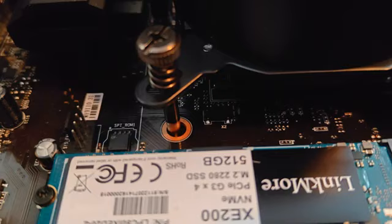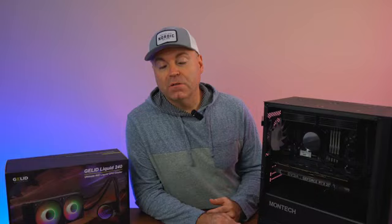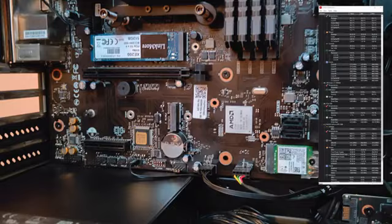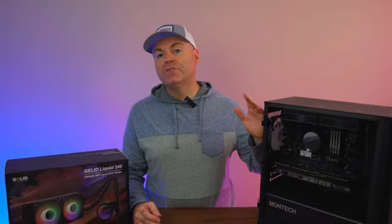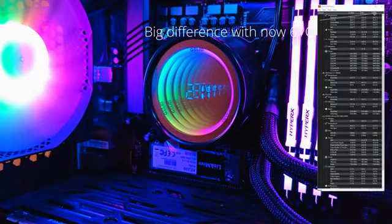You will see the temperature comparison — how the Ryzen 5 5600 performed before this upgrade with the 240 versus the old Omen 30L with the 120 AIO by Corsair, which actually makes that one for HP. The difference is big: 240 versus 120, and even in an open case the 240 performs much, much better. In addition, it's much quieter even at the highest RPMs, and it has a lot more options with the RGB, the temperature display, and all that. To me, that migration is definitely worth it — $60 for the case, $80 for the Gelid AIO, $140 total upgrade. I'll just grab a fan controller, throw it in there, lower the RPMs, and make it more pleasant for the ear.